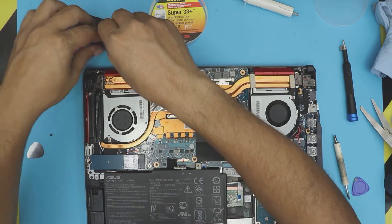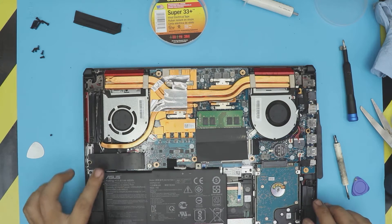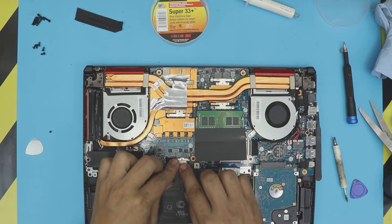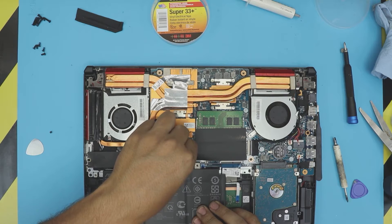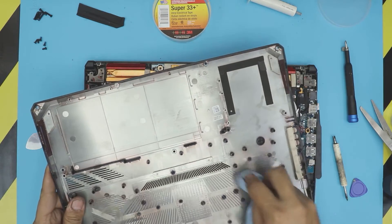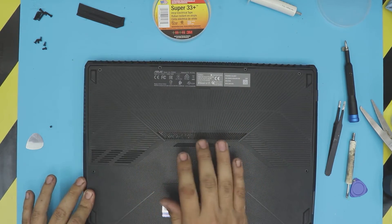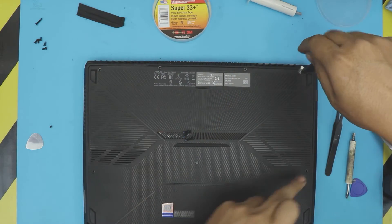This cover is really up to you if you want to put it on — it's not 100% needed, it just prevents things from showing through the openings of the bottom case. Pretty much we are done. At the end, all we need to do is put the power cable back in — align the jack, put it straight in front of it and slide it all the way in. Grab the bottom cover, clean it up, and just put it on, pushing down the corners, the sides, the back, and the front. The last thing is to put the screws back in — remember the longest screws go all the way in the back where the heat sink is, and two side ones as well.